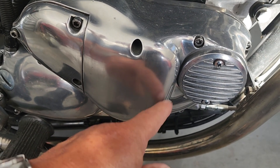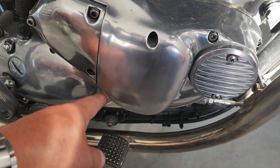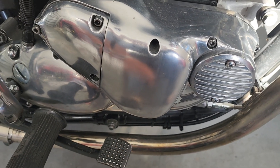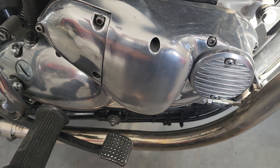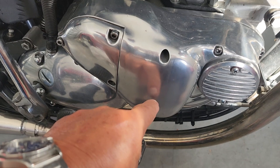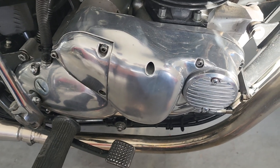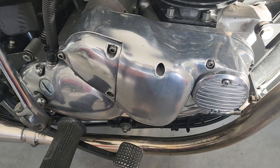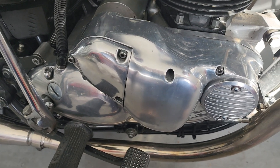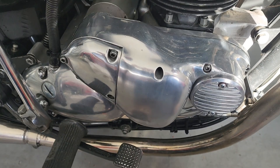From the timing chest there are vents that allow oil to get back into your crankcase. So what's happening is your pump is pumping oil up to your oil seal, it's leaking past the seal and going back into the crankcase. 90% of low oil pressure problems are because of that oil seal — simply changing it will solve your problems. Also, if your oil is worn past 1500 miles it gets thin, squirts past the seal easier, and your oil pressure drops even lower. Changing your oil every 1500 miles and keeping that oil seal in good condition will keep your oil pressure up.